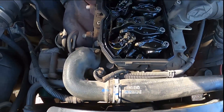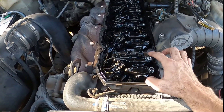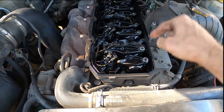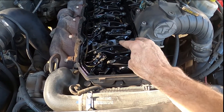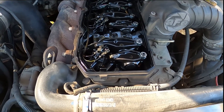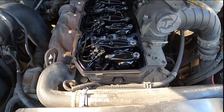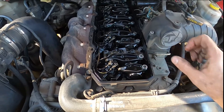The next step — with the battery still disconnected — is to check if cylinder one's rockers are both loose. Cylinder numbering goes one through six from front to back. In this configuration only one rocker is loose, so we need to rotate the engine one more full 360 degrees. That will be true top dead center, and both rockers will be loose. Then we can start the adjustment sequence.